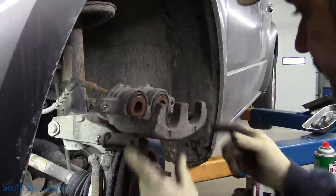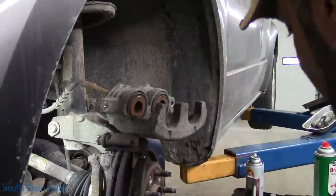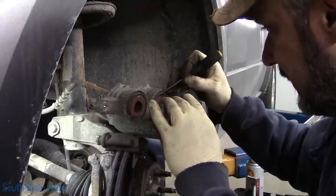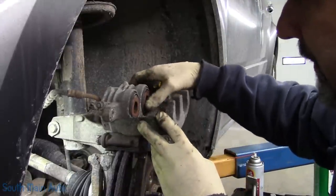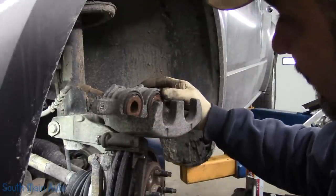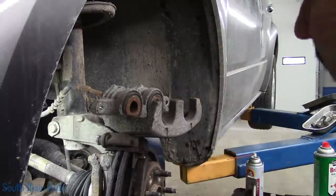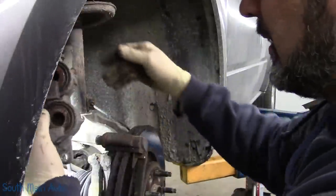Now we've got a little bit of air around this boot — you can see how she's kind of hanging out there. We're going to get a screwdriver and very gingerly keep it pointed at the piston, work it, find that little lip in here where it hooks on, get underneath it, open it up a little bit, and the air comes out. So now our piston boot, our little dust boot, is nice and flat. Why let the air out? You have the potential for that boot to actually fold over in front of the piston, and when you get in there pumping up the brakes, it could be caught between your pad and the face of the piston — then it rips the boot, and next time you've got to do brakes the caliper is garbage, or it seizes up in the meantime.